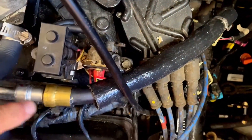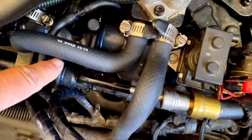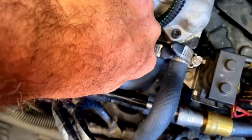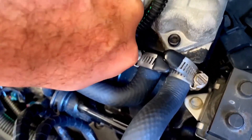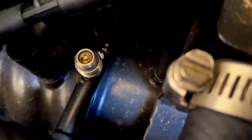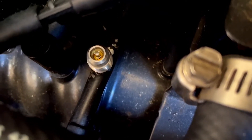This is the fuel line — it goes down around the back of the motor, down to the cool fuel module and fuel pump. It comes up and taps into the fuel rail here, and you're going to see there's a cap right here that you can unscrew to access the port. It looks like a tire valve — a Schrader valve. So you're going to screw the fuel pressure gauge onto that, start the engine, and see what your fuel pressure is.